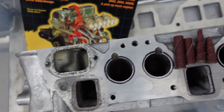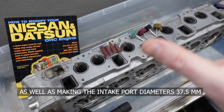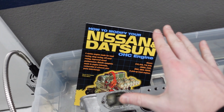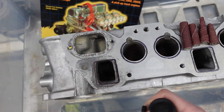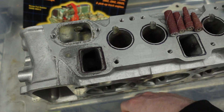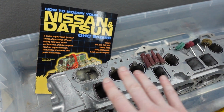I have some marks which I got from taking my future exhaust flange, laying it on there, and tracing them. I'm actually not going to go quite as aggressive as these lines show, mainly because this is just supposed to be a mild port and polish — nothing too crazy. In preparation for this job I did read this entire book, trying to take this seriously and do a good job even though I've never done something like this before. The main goal is to smooth out the walls of these ports and open them up just a little bit, but you have to be careful because there are holes that run through the entire head and you don't want to be too aggressive — you can go into those holes and ruin the whole thing.